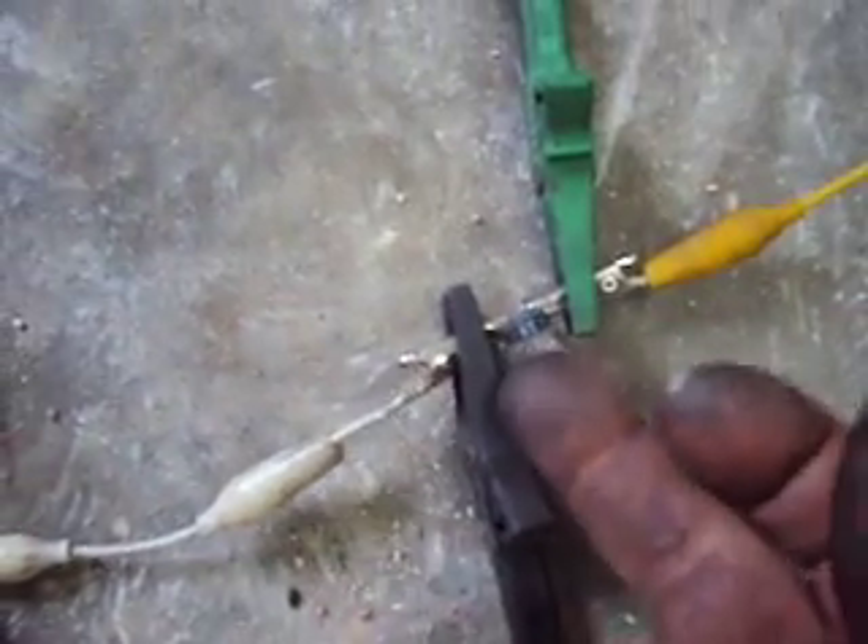I guess this works. I've got it set up here — it's not in the vehicle. I've got my alligator clips on the fuse and more alligator clips on the alligator clips hooked up to the Vantage. You've got to have a pretty accurate voltmeter to do this. It's not 100%, but if you've got voltage drop across the fuse, first of all, to have any voltage drop you'd have to have voltage on the fuse — obviously you'd have to have something staying powered up, a constant live circuit. And then if there's something drawing on it, you could test anywhere on just about any circuit and you're going to find some resistance.